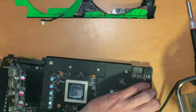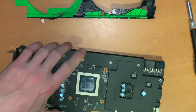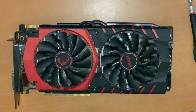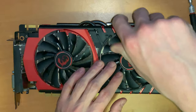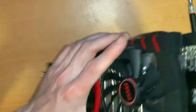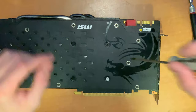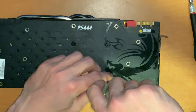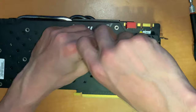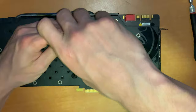So I'm going to put this aside and start tearing down the 980. This is all there is to a graphics card — just cooling. Here we have the next patient. I need to lift off this thermal spreader too. Removing these four screws — it looks like they've already been done, so I expect the thermal paste has already been changed on this one. If it was done badly, I could use my MX4 and potentially decrease the thermals, since this one runs pretty hard — fans spin up to 2k RPM.